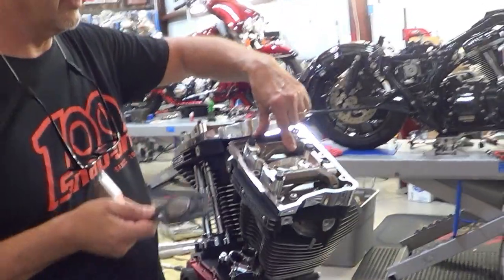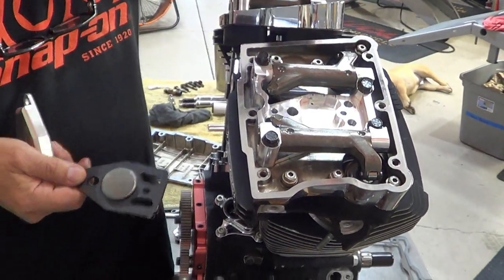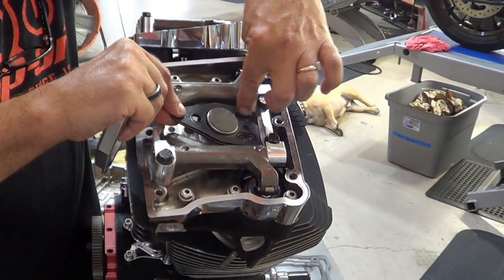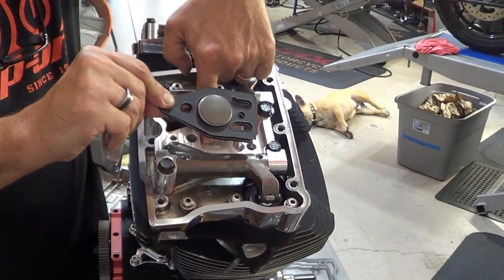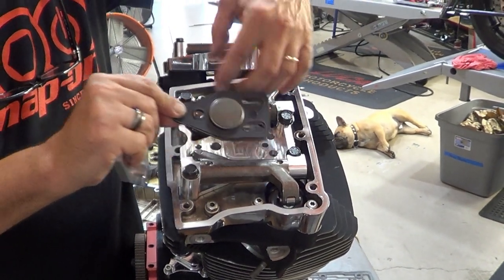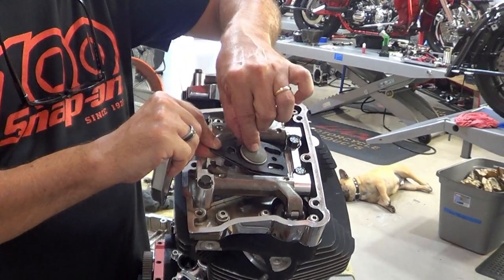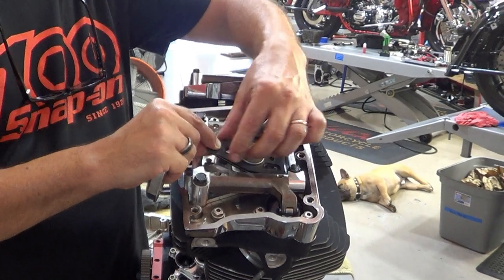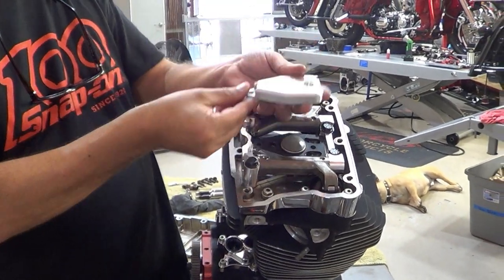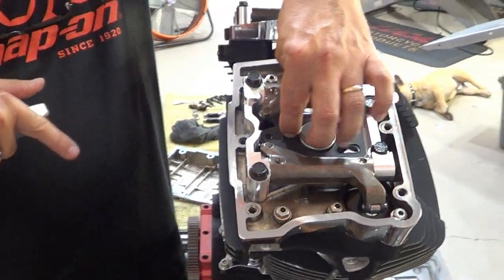One of the things about our breather and the rocker stands that works so well — here's where the air enters. The pressure goes up and in, and this sits here like so. It crosses over right here, goes into this area, which incidentally has the drain-back holes. They're quite a lot larger than a stock piece. So any oil that coagulates in there or gets stuck in the filter will fall down these holes. Pressure in the filter goes up through, the flapper opens losing its seal, it enters this portion of the breather, then goes down this hole which has a galleryway, comes over here and goes out. It's pretty simple in its design. These are significantly stronger than the stamped little pieces of steel. They look trickier, but it all sits together and sits down in there like that.